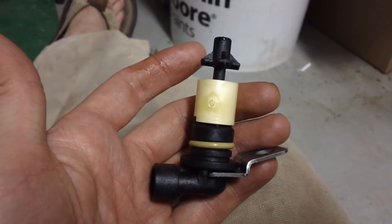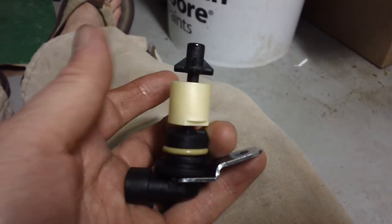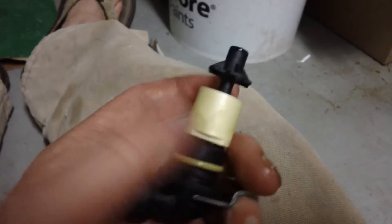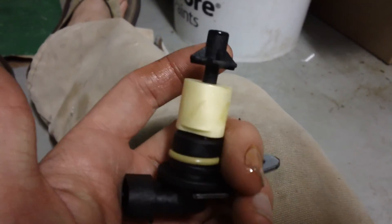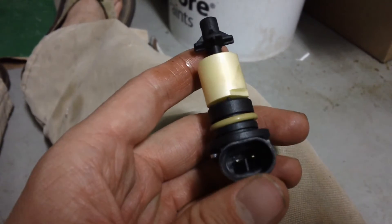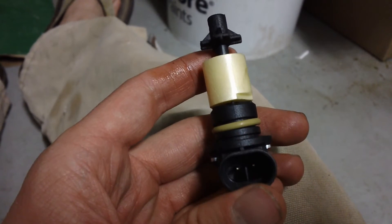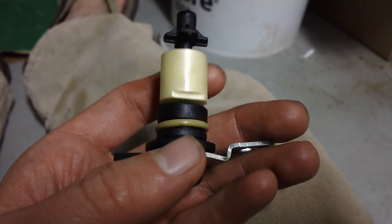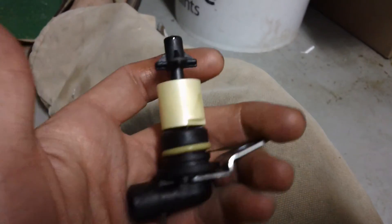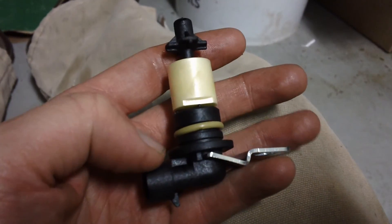The bottom line with oil: you want to check your dipstick on a regular basis because you can't rely on these sensors all the time. They just power a dummy light, basically. Make sure to check your oil regularly, and if you have leaks, look inside the harnesses to see if oil is leaking out of your oil level sensor or your oil pressure sensor. If you have questions about how I install this, go ahead and ask in the comments below, and I'll provide a link to some of the tools I use in the description.